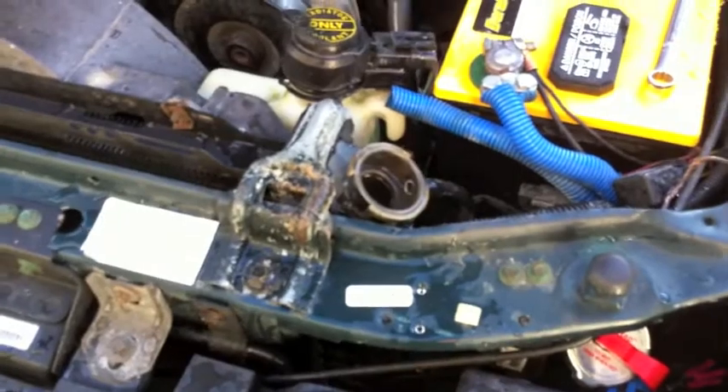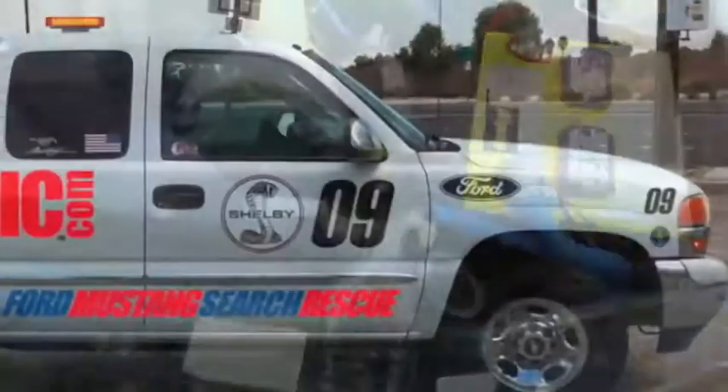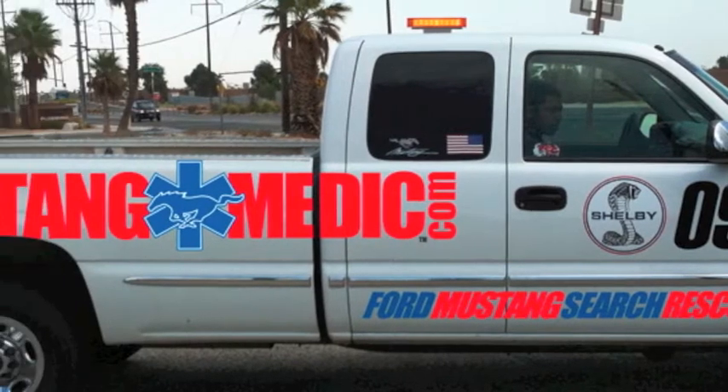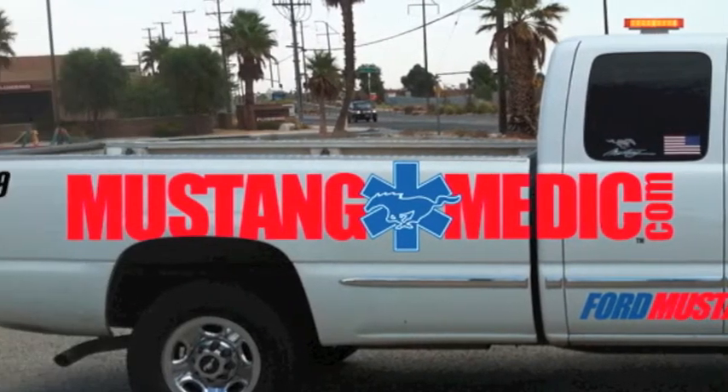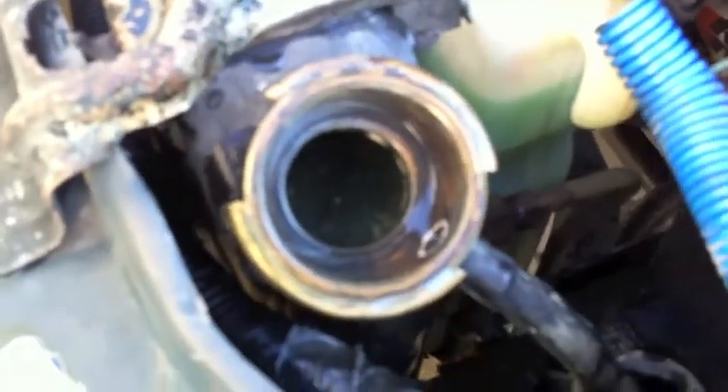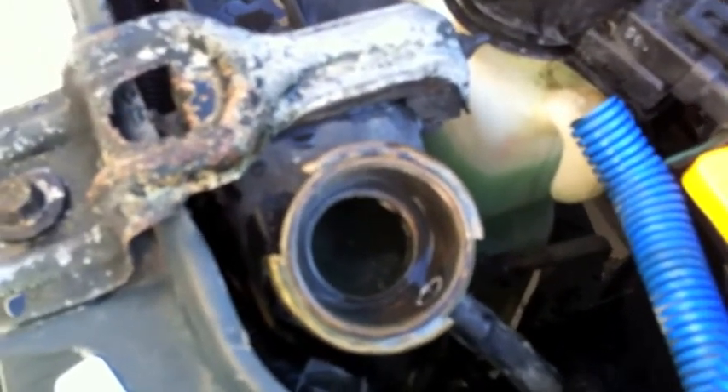Alright, let's burp her — let's run her and burp her. On Day 1 we power-washed this; it actually came out quite nice — it's a quick job and we are pleased with the results. Power washers are awesome. Ricky is going to start the engine up and we are burping the radiator to see if there are any air pockets in it, because it was about 6 inches low on water, which was not helping the car run cool last night.